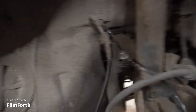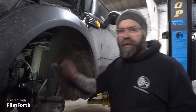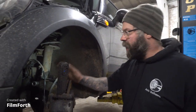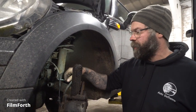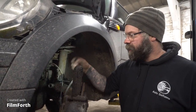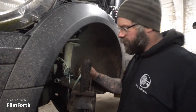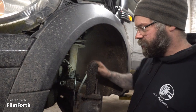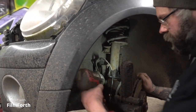I've cut the anti-roll bar link on this side and taken the pipes out as well — got to be efficient so I don't want to be all night. We've got the driver's side off now; this is the passenger side and this is complete. I've already disconnected the brake pipe, ABS, and the brake pad wear sensor. You've got to be extremely careful not to damage these because that will ruin your day. We've got the 18mm socket on the nut and we're going to give it the big impact gun and see if it's got enough.